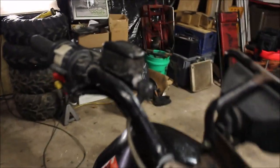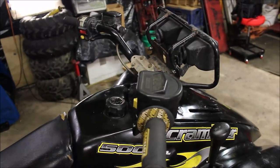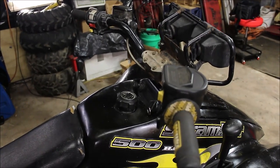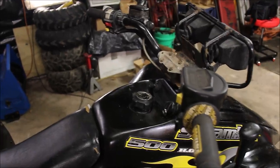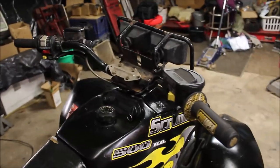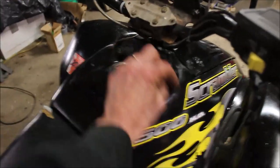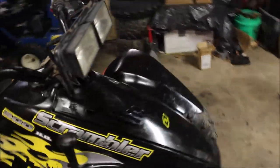Go ahead and plug them back in. I hotwired the fan and had a couple people asking me about that — if you want me to shoot a video on how to hotwire a fan, I can do that. I do it because I don't trust the sensors. You could be riding and a sensor could go out and you overheat the motor.